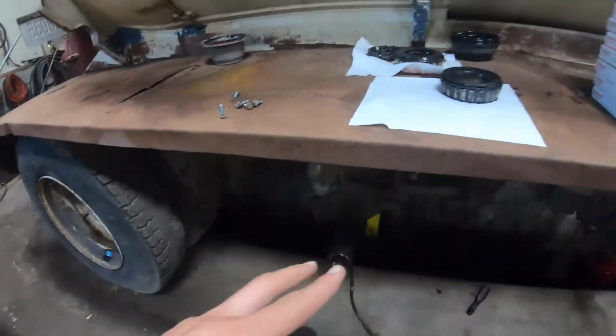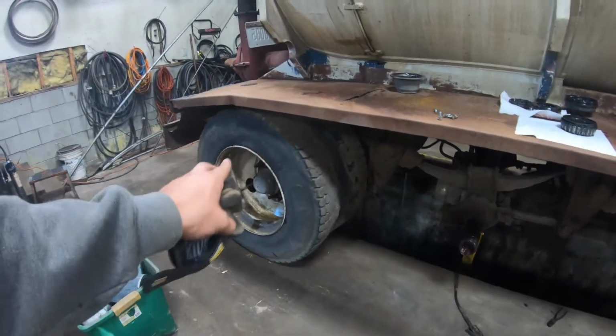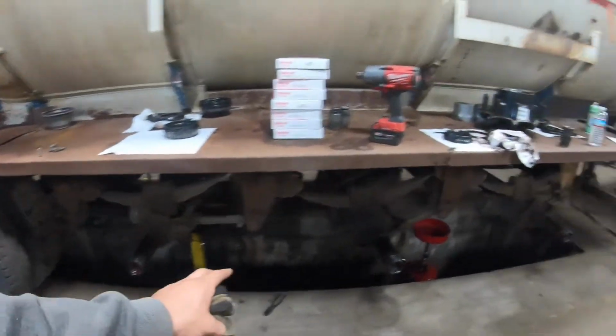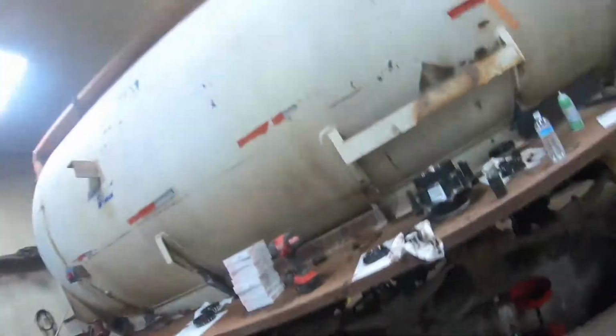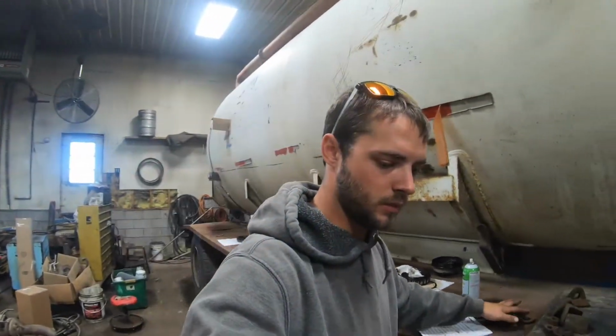And then we got to put these two axles completely back together, and then we can take this one off, and we're going to put the brake drum off of this one up here because we're going to run the two older brake drums up front because the back axles are the parking brakes. So we want the new drums on the parking brake axles. So here we go.